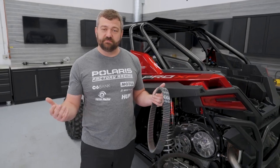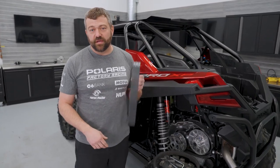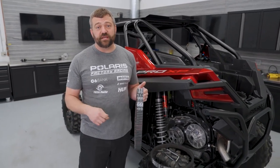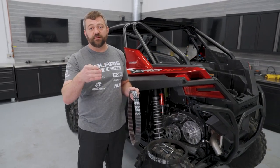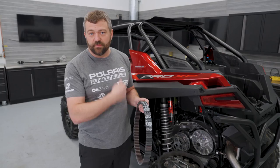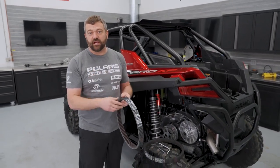After you've been running hard - say going for long pulls or climbing Oldsmobile Hill out in Glamis - you end up getting a lot of heat in your belt. One of the best things you can do is shift into low gear and run for a mile or two at a moderate pace, because in low your clutches spin faster, giving you more airflow through. It'll pull the heat from the belt into the clutches, from the clutches into the air, and exhaust it out.